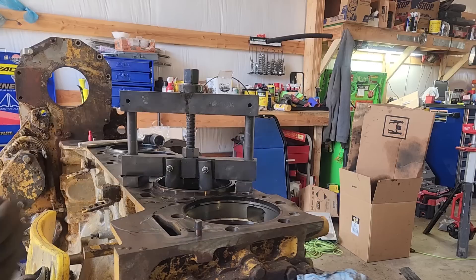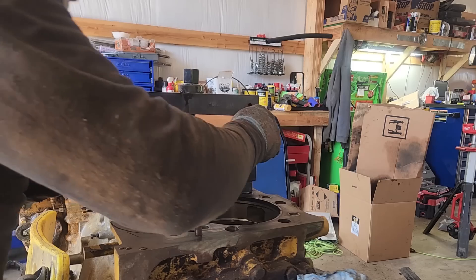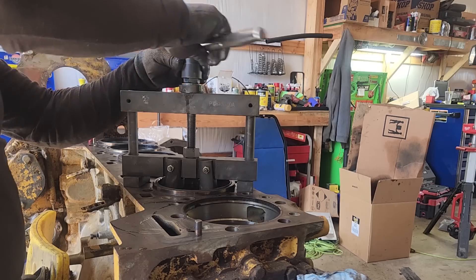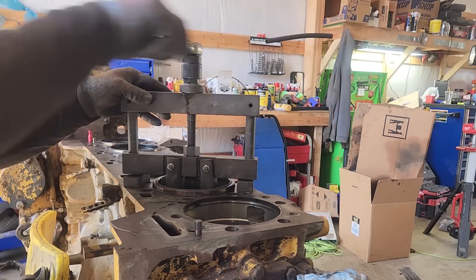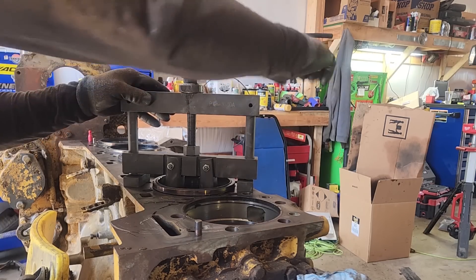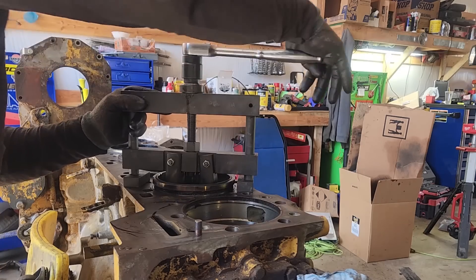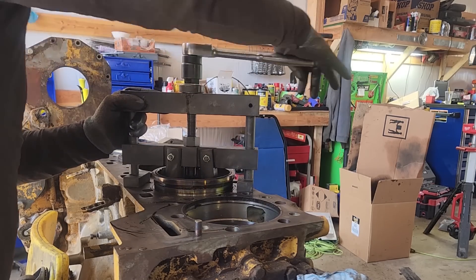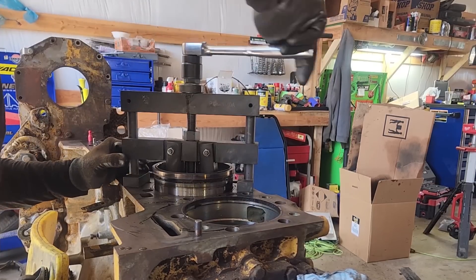Also regarding cavitation — if you're going to get it, it's usually on the exhaust side, which would be the right side, which is kind of what I was pointing out there. Once the liners are out, that's basically it. You could see the cooling jets had already been removed. You always want to pull the cooling jets before pulling the pistons out — you don't want the connecting rod contacting them and potentially damaging the cooling jet. They're expensive, and if you damage one and reuse it, that could really do damage to the engine.